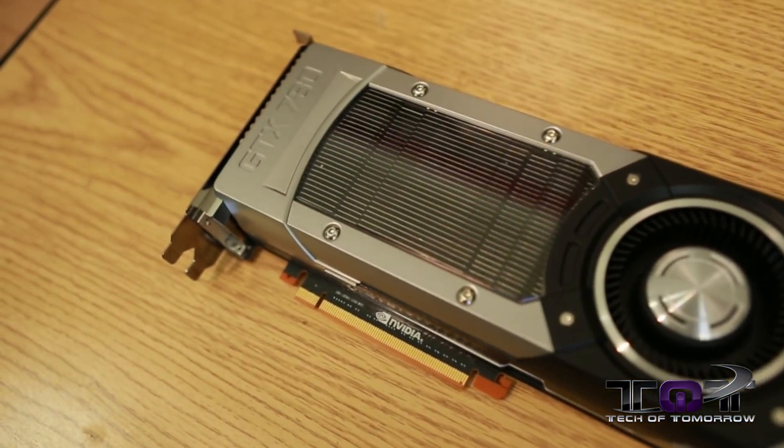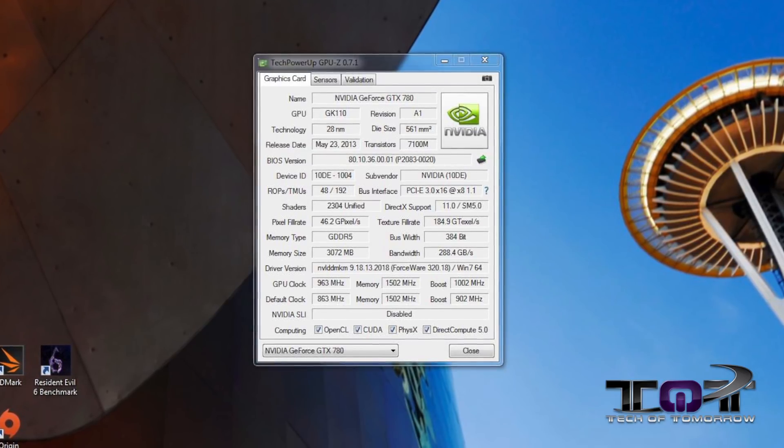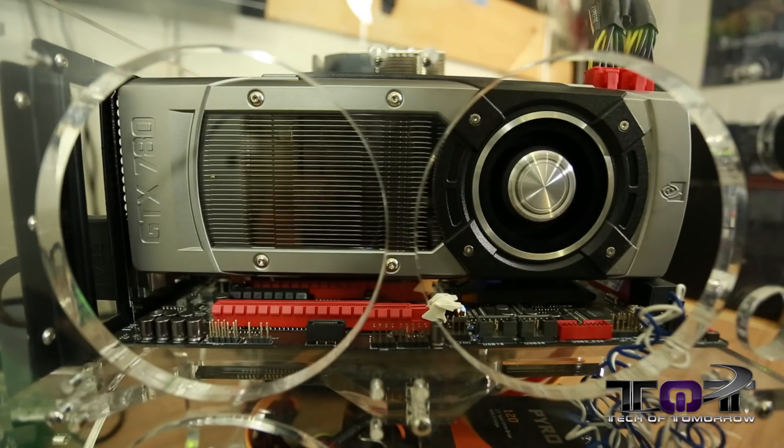What are we bringing to the table now? Well, today we're going to show you guys how very easy it is to overclock this card using EVGA's Precision Tune software. We were able to overclock the card 100 MHz, very simple, and we got some actually pretty decent results. As a general rule of thumb for the beginning overclocker, you only want to do things in increments of 10 MHz at a time. That way you can make sure that everything is very, very stable. We just kept increasing it until we got there, and we left it at that due to the fact that we're not having extreme cooling on — this is just the reference-based cooling, and we didn't want to fry the card out.